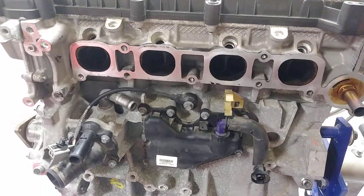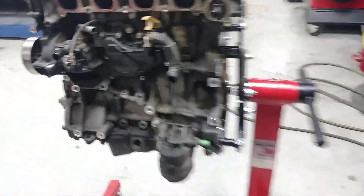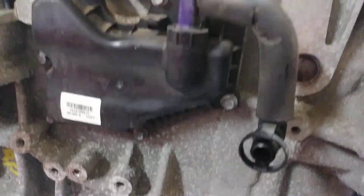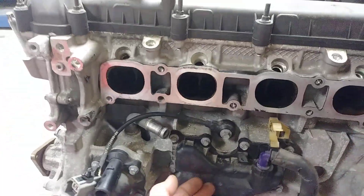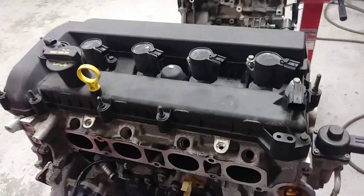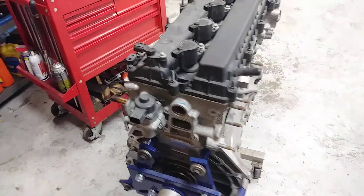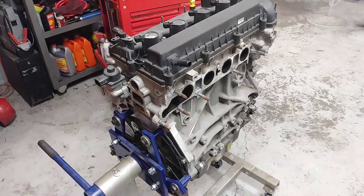I'm going to use the original 2.3 intake that came on the car, so I have to change this PCV tube and valve — one's a regular hose with clamps and this one has a hardened plastic hose that clips in. I may just end up running the Fusion PCV valve and tube and it should be fine. I am going to run the Ford Fusion fuel rail and injectors — that's what I did on my Mazda 3. It ran well; the long-term fuel trims were around minus 15 but never set a check engine light, and I got 30 miles per gallon.